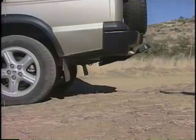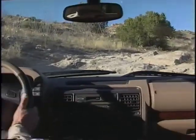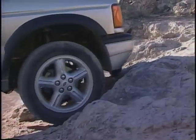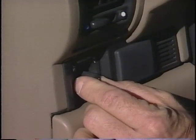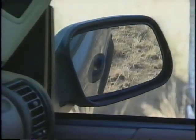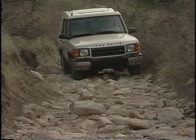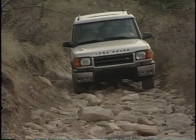You will need to know where to place the vehicle when driving over uneven terrain in order to protect those components. Inspect front and rear overhangs. Get a feeling for available clearance, so that when approaching an obstacle, you'll have an image of the critical parts of the vehicle. When driving off-road, adjust the side mirrors down to show the rear tires, helping to alleviate blind spots so that the side walls can be seen when passing close to rocks and stumps.